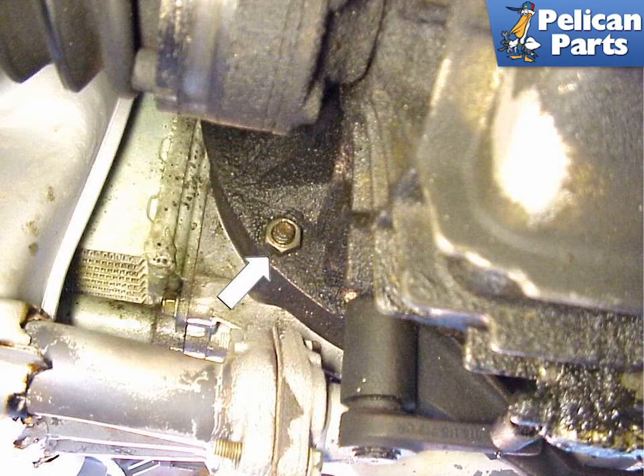There are four nuts that hold the engine to the transmission — the white arrow is pointing to the lower right one on the transmission. Removing these nuts will not make the engine less stable because there are four studs that exit the engine case and are inserted into holes in the transmission case. One or two of these nuts may be difficult to reach using standard tools — you might need extensions and universal socket wrenches in order to obtain the right angle for removal.